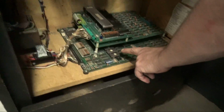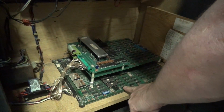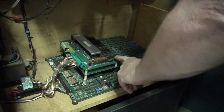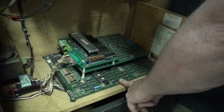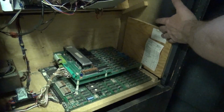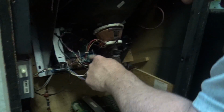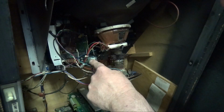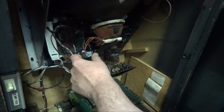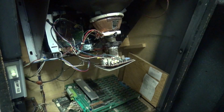It's just a different build on the cabinet. The monitor's mounted the same way, but look, somebody spent a lot of time arranging this. There's the original Q*bert board, okay? And this is the Frogger board, and this is apparently a bootleg Q*bert board. Very unusual. Notice the side layout here is different, and this uses a 4600, and it looks like this relay must flip the screen because it's hooked up to the yoke. I guess the Q*bert, they had to turn the screen the other way. Somebody went to a lot of trouble.